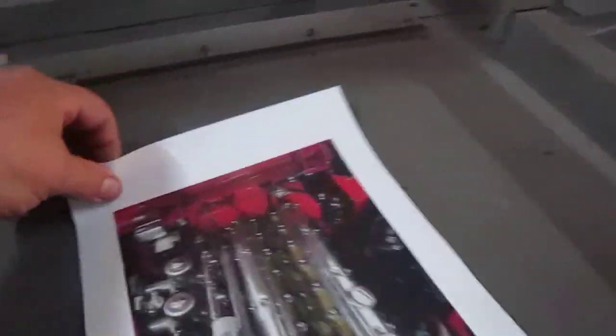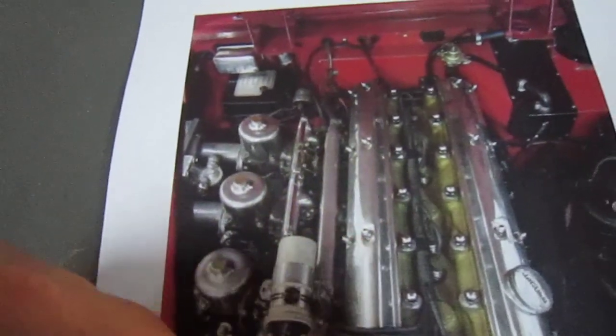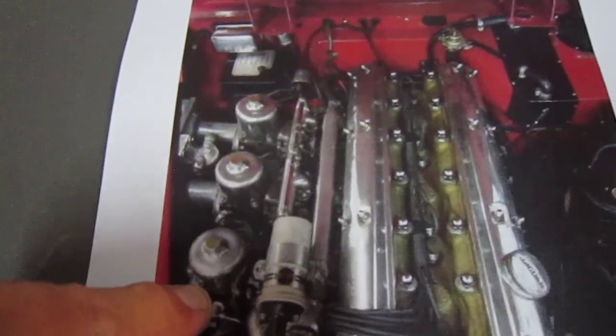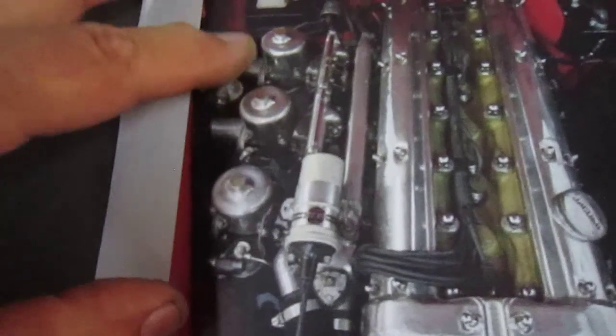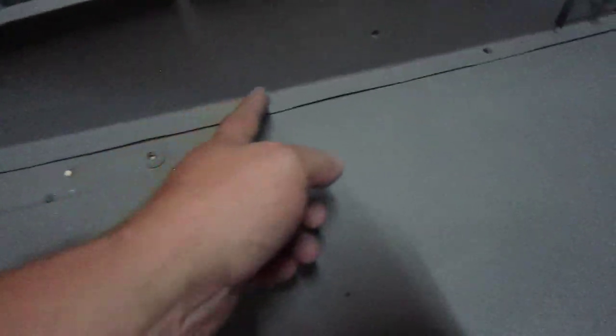The other thing I wanted to show you is this S-type. We're using the original 3.4 engines but with straight-port E-type or S-type heads, because the valves have to be a certain size, and triple SU carburettors, which I have on my E-type there. You can see there's an issue with this last carburettor — this one has an air box on it, and we're not going to go with the air box inside the wing. We're going to use pancake filters — chrome pancake filters. If anybody's done this conversion, I'm not sure exactly how much needs to be cut out on this wing. It looks to me like they need to be cut about here somewhere to allow the pancake filter, and the fuel flow seems to be a bit of an issue on that corner.